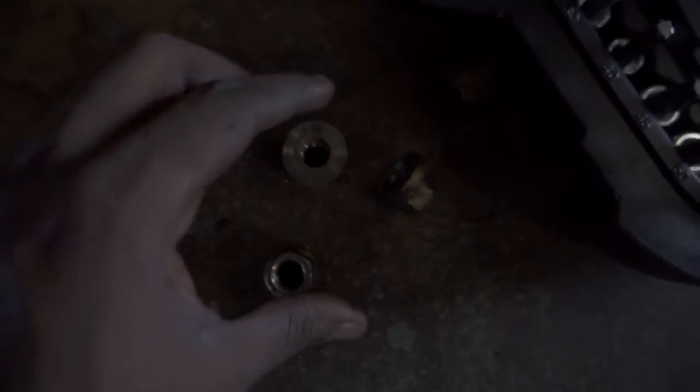So these are all four of the nuts. All right, looking back at the video, I think that we shouldn't have taken the nuts all the way out. I would say you guys just unscrew the nuts until they get towards the end of the stud, so that way when you undo the cross member, it can lean back safely and still have the nuts in there to sort of secure it. Now, after you get these four nuts out, you also need to remove your exhaust.